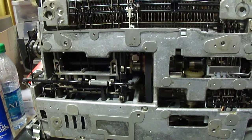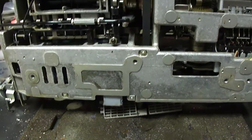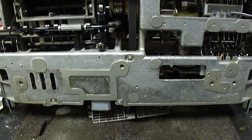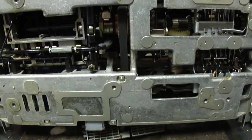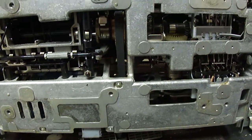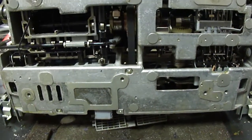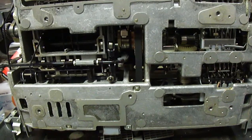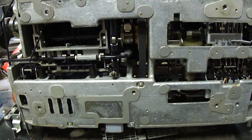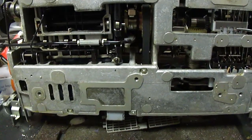The first problem with it was that the motor would not come on, and I tracked that back to a bad power switch. Right now I've just got the power cord hooked up directly to the motor with some wire nuts. I need to try to see what might work best as far as a power switch — maybe a micro switch or something. But for now it's set up so it needs to be controlled with an external switch, like from a power strip.